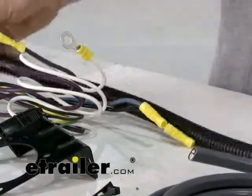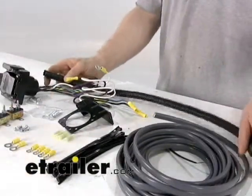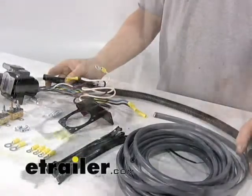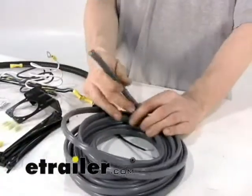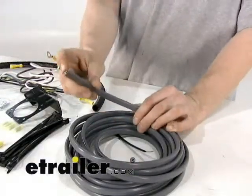This loom is to cover the wiring from the adapter at the rear to the beginning of the cable up front. The next step is to run this cable back up to your battery, which will provide power for the black wire — a 12-volt power supply going to the rear.